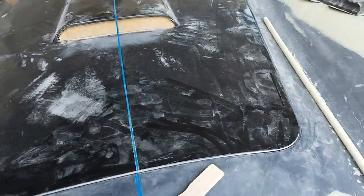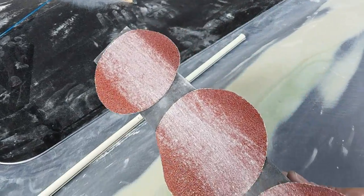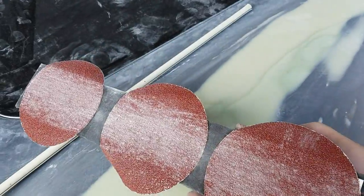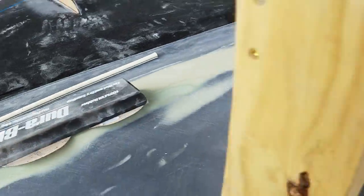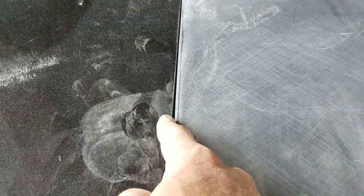the hood. I didn't use any machinery because I was afraid I was going to take too much off, but I used this long board. That's all 40 grit on there, and I just tried to make long smooth strokes the best I could. And then around the radiuses I used this little guy with 40 grit as well, and you can see that I haven't gotten all the way in there, but I also haven't scribed this back side yet.